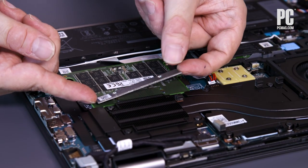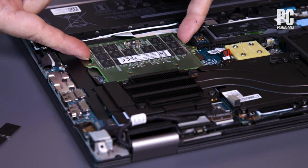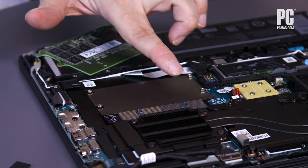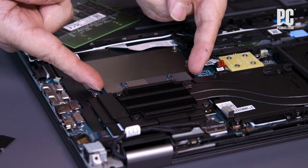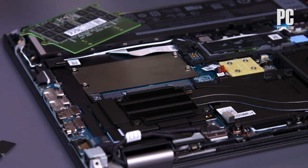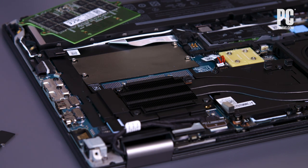There's a little metal plate here, and removing that exposes the entire module. You can take the module out and place it aside, and you'll notice there's an interface strip — an interposer — that basically lies between the memory module and the motherboard. If you take the interposer out, you'll see a whole bunch of small contacts underneath, very much like the bottom of a CPU. In referring to it as a Compression Attached Memory module, you can see that principle in action.